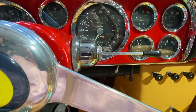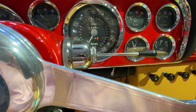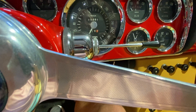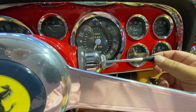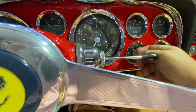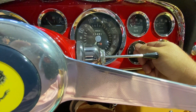Another interesting thing on this car: it does have an overdrive. So when you're in fourth gear, it in essence has another gear, which is handy at higher speeds on the freeway. All you do is use this little lever — when you're in fourth gear, you do not have to do anything with the clutch, but you just push that lever forward towards the dash, and it will engage the overdrive.